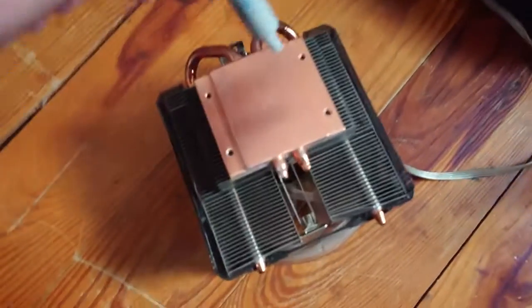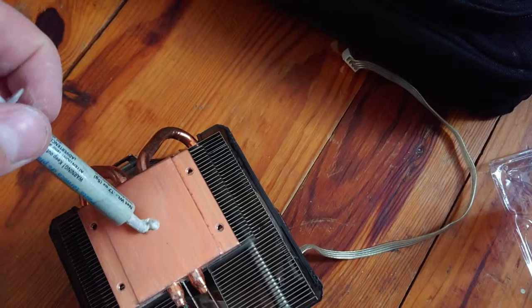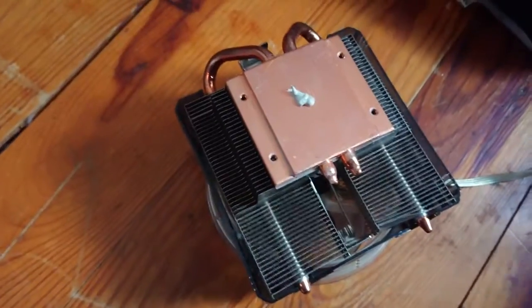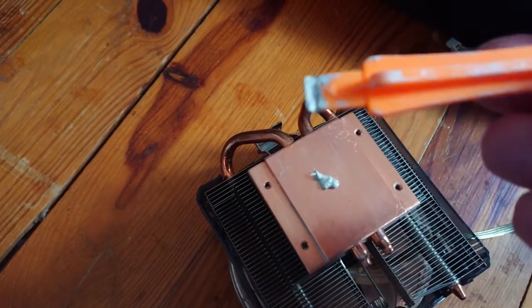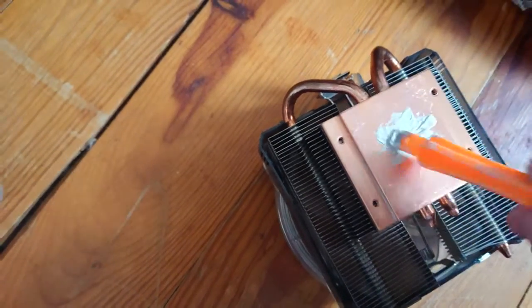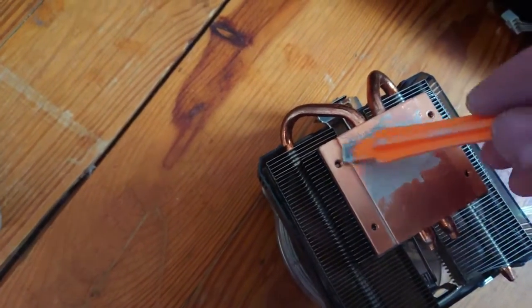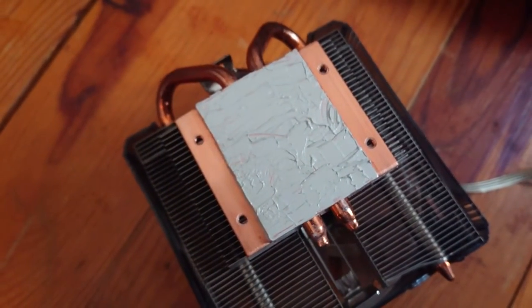This is the thermal paste. You just pop the cap off. I like to put just a little dab — not too much. I've had this for years. You just put a little bit, just enough to where you can smear it across the full surface area of whatever platform you're putting it on. It also came with a tool to help spread and smear it — just like a little pitchfork. I just kind of paint it on there. Once you get the full surface area of the heat sink covered, you know you have a proper application. I had to apply two or three more drops, but that's basically what I like it to look like before I put it on — this is the pre-application stage.